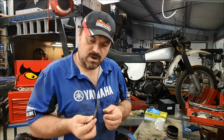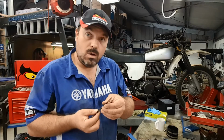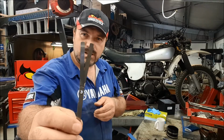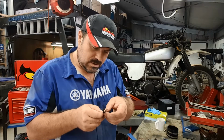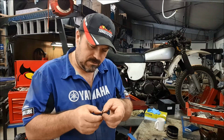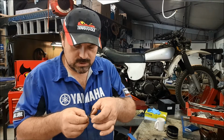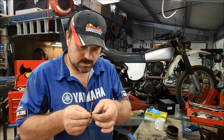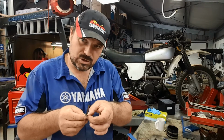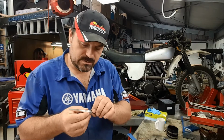And I think to try and find a feeler gauge of... We have one. Look at that. I've just found it. Okay, so we've got exactly what we need. It was stuck to the 0.02. These things are just foil, it's so thin. So we will use the 0.03. And if it doesn't go through, it's a pass. And if it does go through, it's a fail.